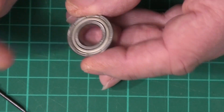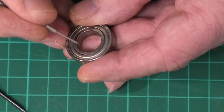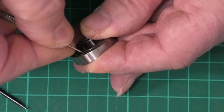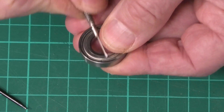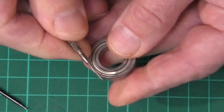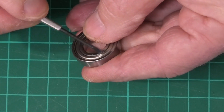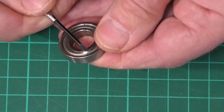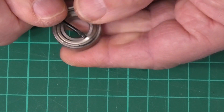So what we do now is get a sharp screwdriver and just push that in there and lift it up. Now we need to be very careful not to push it in too far and actually damage the ball retainer. We just get that in and you can see there it's just lifting up the shield on that inside edge. We'll lift that up. Now with a little bit more space I'm going to put in a slightly bigger screwdriver just to lever that up. There we go — and that's come out.